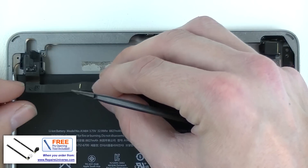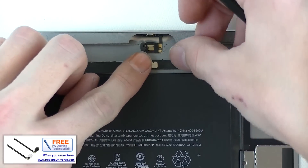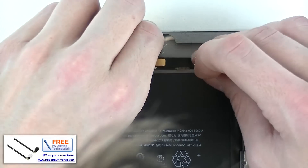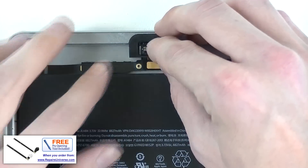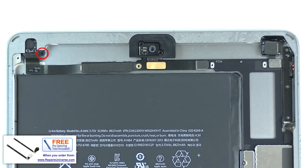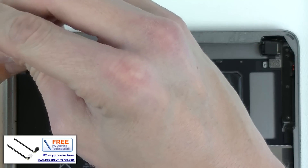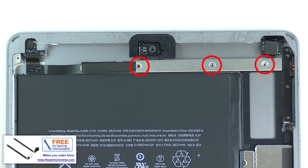Repeating the previous steps in reverse, insert your new headphone jack replacement into the slot of the housing. Lay the flex cable back down in the original spot and secure the connection by pressing gently on the socket until you feel it pop into place. Now reinstall your front facing camera by laying it down in its correct position, secure its flex cable connection, then reinstall the black spacer. Secure your headphone jack by reinstalling the screw in the location circled in red. Next, reinstall the silver bracket by lining up the screw locations, then installing the three small Phillips screws circled in red.